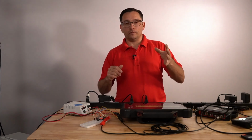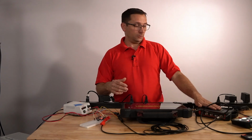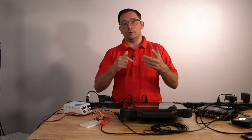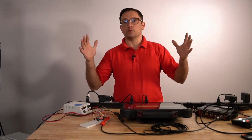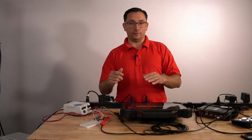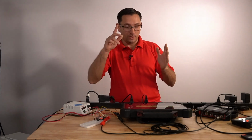The next important thing that I want to talk about is our sample rate. This scope has a pretty powerful processor or whatever is inside of it to make it go. I'm going to demonstrate to you how we can get a 20-second capture and still have a pretty darn clean signal on this crankshaft sensor. The fastest pulse on this is around 40-something microseconds pulse down.